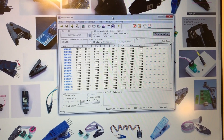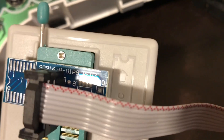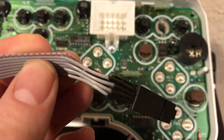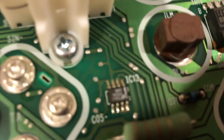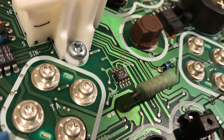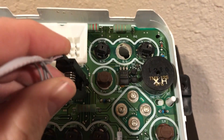This is all just USB from my laptop to the EEPROM programmer. I have my adapter in here — it makes a note of which pin is which. Pin one is at the top left of my programmer. On the ribbon cable there's a red stripe for pin one. On the IC itself, pin one is on the top right indicated by a little dimple. When I orient the clip I need to match that pin-one location correctly.